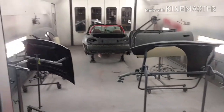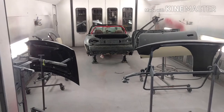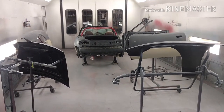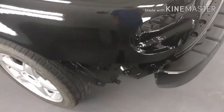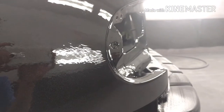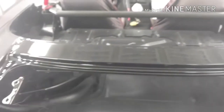Excuse me, allergies are real bad. Anyway, enjoy and next time I see you guys the car and all the pieces will be painted — stay tuned. Alright, we're back and the car is painted. Obviously I have some issues with the paint — it doesn't want to adhere very well to any of the surfaces. You can see how it's sagging right there like little fat rolls. It's not orange peel, it's sagging because the paint didn't adhere and cure to the primer. There are a lot of spots that came out really clean though, like this spot up here came out real nice.